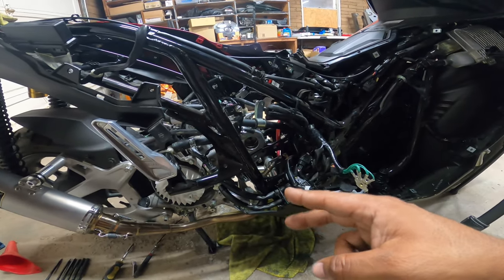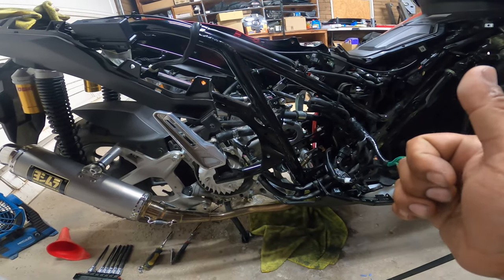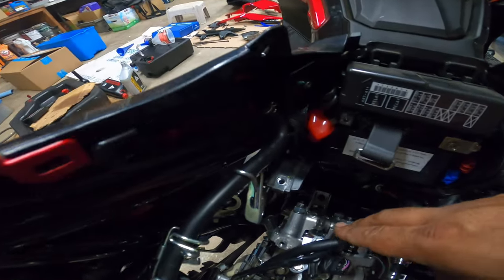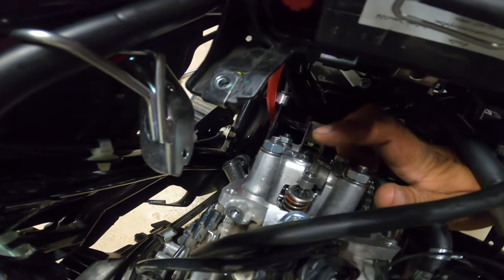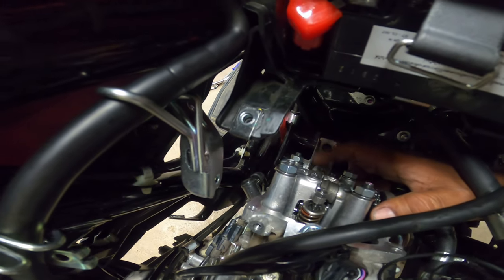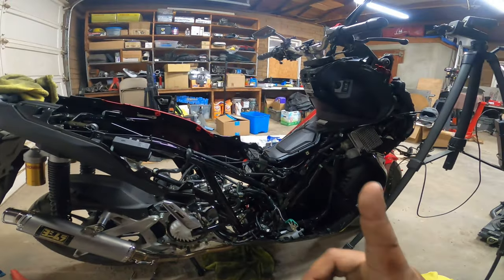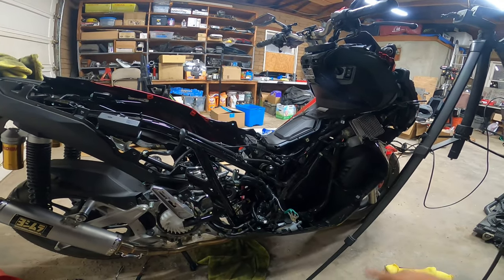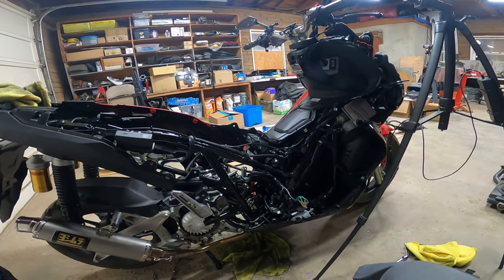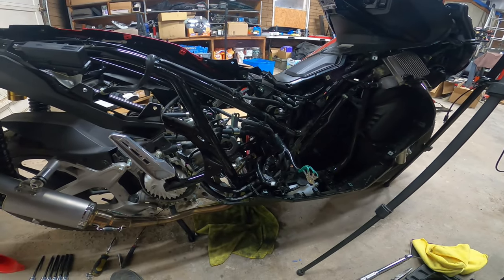Now, number two, number three is the valve adjustment. On these guys, again, I'm leaving the entire manual in the description for you guys, but for the intake one, it's 0.004. For the exhaust one on the back, it's 0.009, okay? And you're allowed to add plus one, so plus 0.001. So you can go all the way open to 0.005 or 0.010 on the intake and exhaust. That's it. You can't do any more.